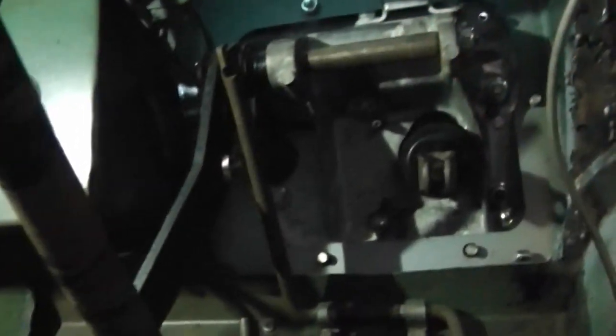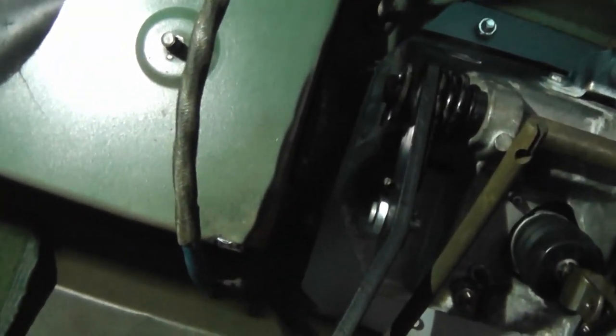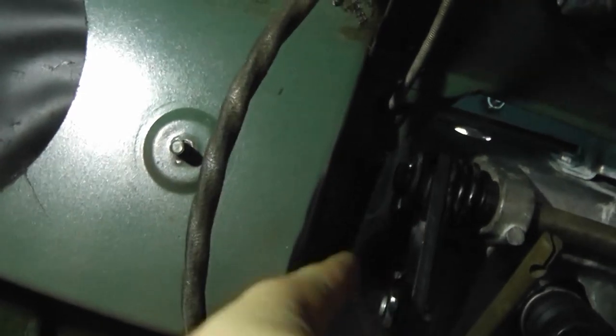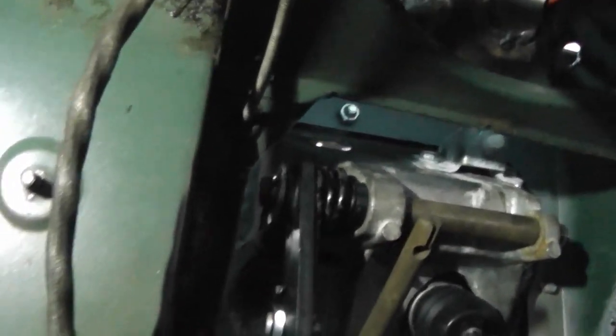And talking of the throttle, I now need to turn my attention to that throttle pedal and sort out the rod there. Before, I said I was going to shorten or lengthen it, but I think the more efficient thing to do might actually be to lengthen that shaft so that the upright portion is moved across so it operates on this side of the clutch pedal, and it should just about fit in a gap there. I might have to open up a bit more metal, but that shouldn't be too much of a problem.